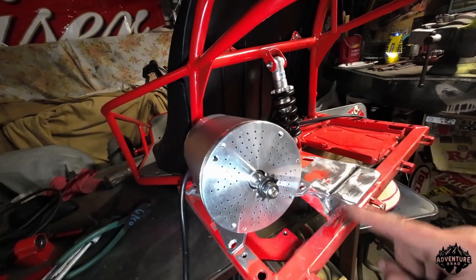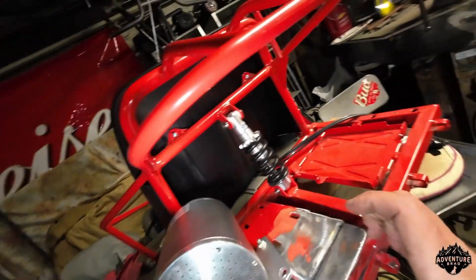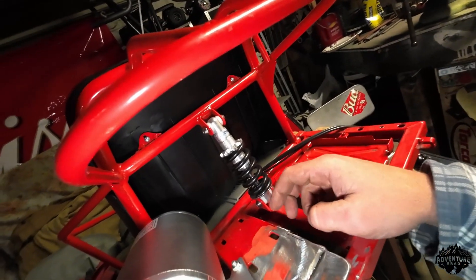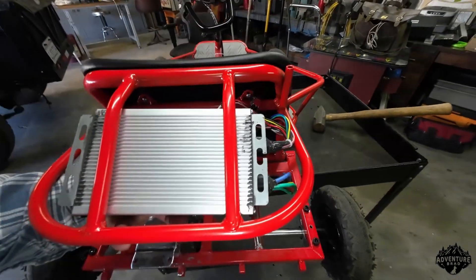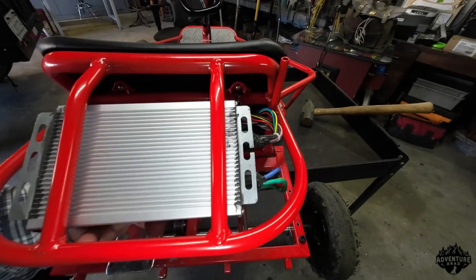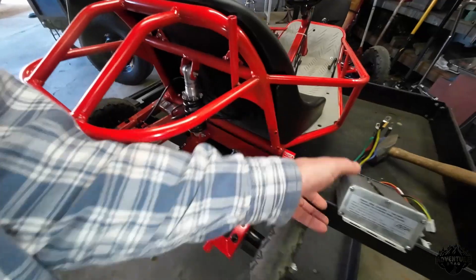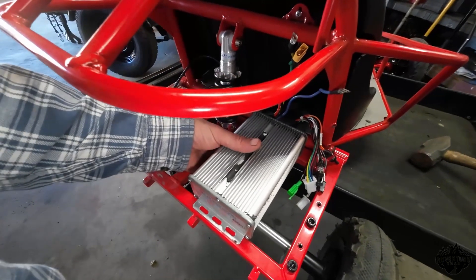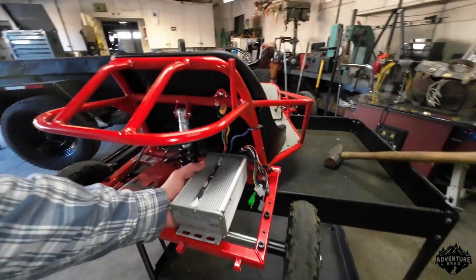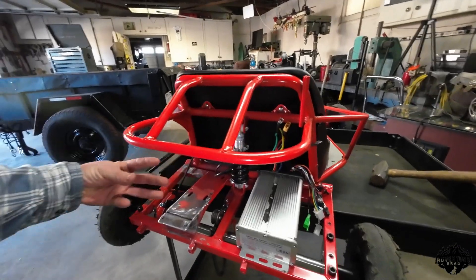So I got the mount on, welded it all up. A little bit of buffing and sanding — I'll do more later when I pull this off. I haven't decided what I'm going to do here with this, but for right now that's on. Start drilling some holes. Hindsight being what it is, I would have wished I made this plate wider, but it is what it is. I think I'm foregoing my plan of mounting it here — it would be good for vibration dampening but I don't like the looks of it. Plus we have an interference problem with my motor. So I cut the bracket off — it held the battery here, and that was ugly and vestigial. I think we're going to mount this down here with some nut-zerts and try to come up with some springs or rubber so it's isolation damped. This will look clean — I'll have the controller here and tuck all the wiring in the back. Motor here. Simple.